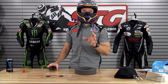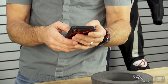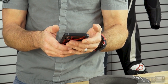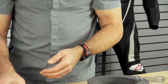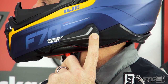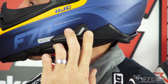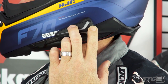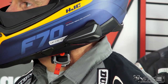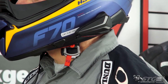Now we're going to show you how to pair up the 20B with your smartphone. Get into the settings menu — Bluetooth. Power the unit on. This is the center button, this is the plus, this is the minus. In order to power it on, press and hold the center button and the plus. You'll hear a message — 'preparing headset' — followed by 'hello.'